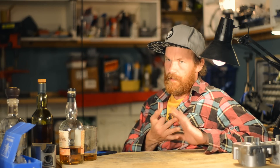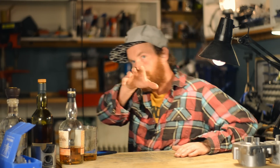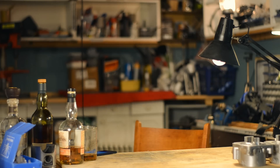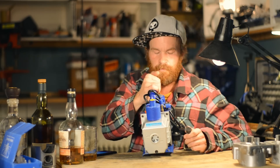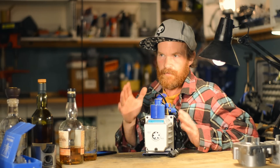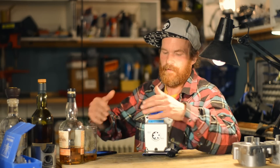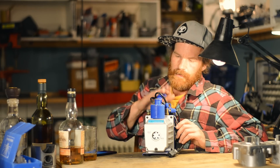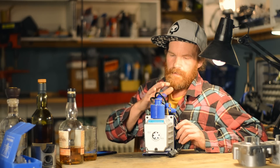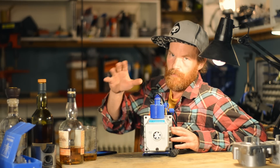As of now, I can do the designing, the printing, and the casting. I will try to improve upon the porosity in the casting — I bought a vacuum pump and I will try to do vacuum-assisted casting, applying vacuum to the flask as I'm pouring to suck the metal into all the nooks and crannies and hopefully extract some of the gases. So, more casting trials. I can do the plating now — it seems the plating is too soft, but I've got the silicon carbide powder and I think that will work.